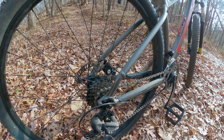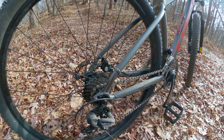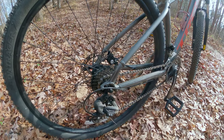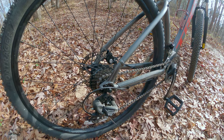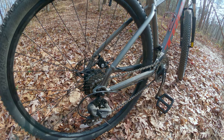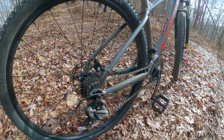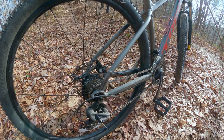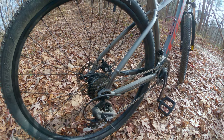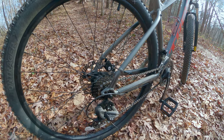If you're looking for an entry-level bike that gives you freedom for upgrading, I'd recommend at minimum the Trek Marlin 6. Its rear hub is a 6-bolt Shimano freehub with 8, 9, and 10-speed capability, so you can run up to a 10-speed cassette in the back.